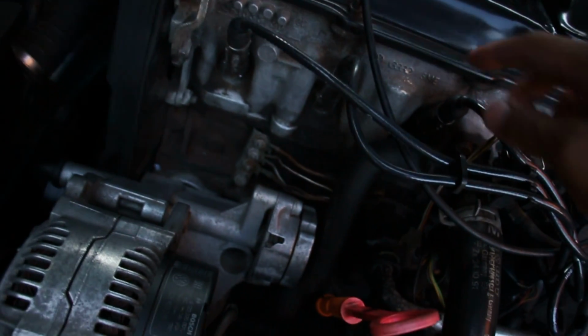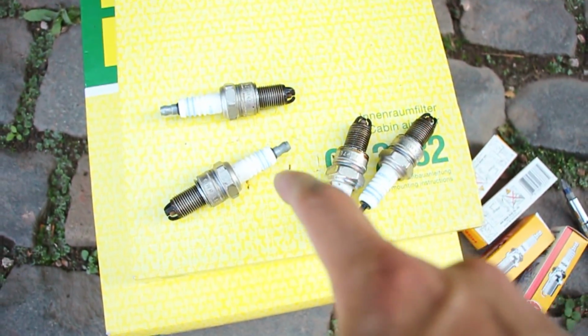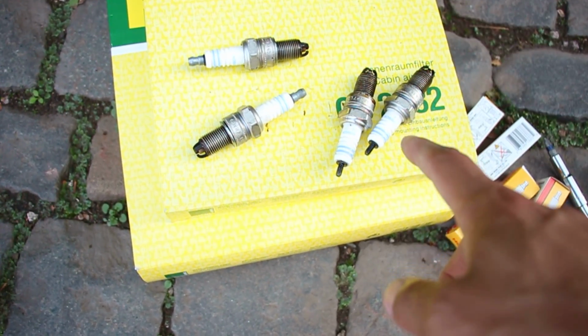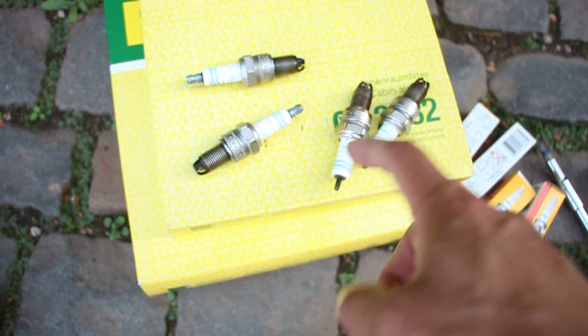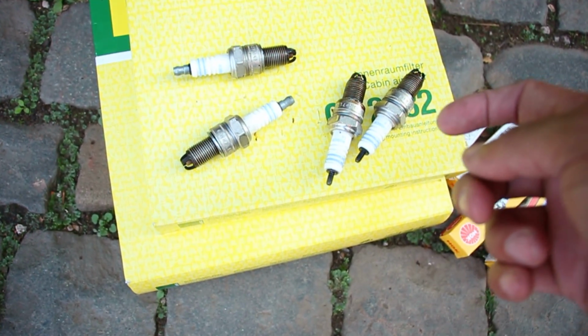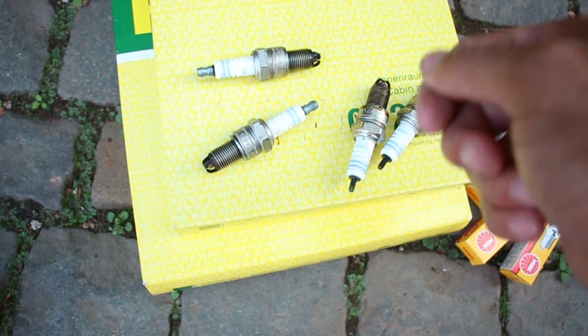And then I tried something else. I pulled this little top piece back off. I thought it was so weird they would sell me spark plugs that didn't have the piece, but I don't think I need that piece, because what I'm finding out now is the inside of the plug wire itself is hitting on here and it's actually not popping on properly.